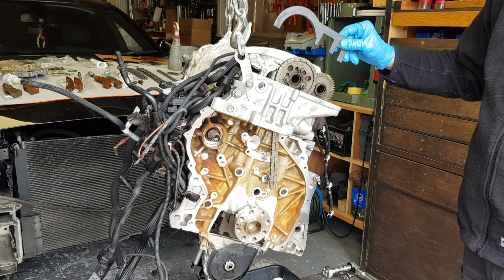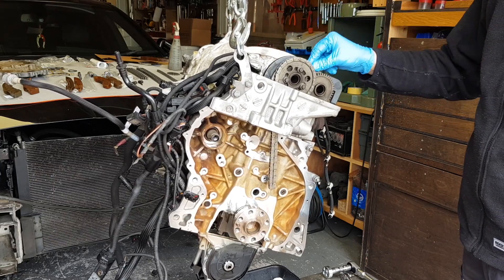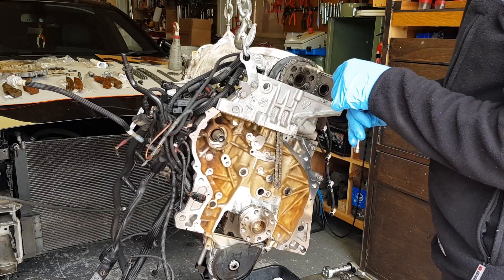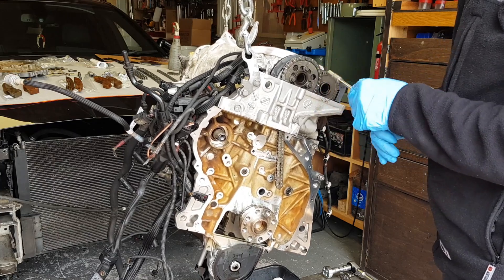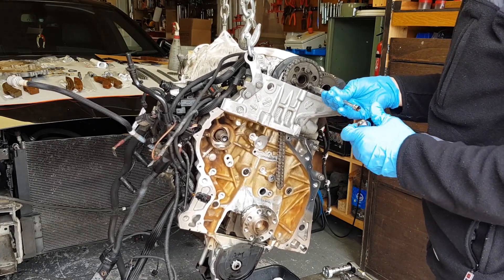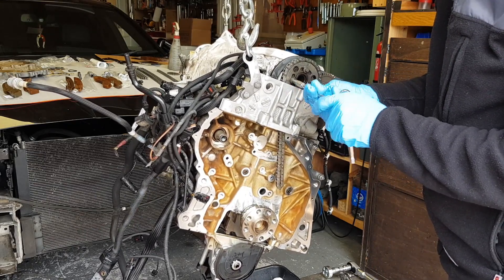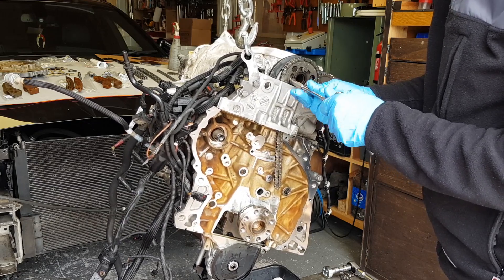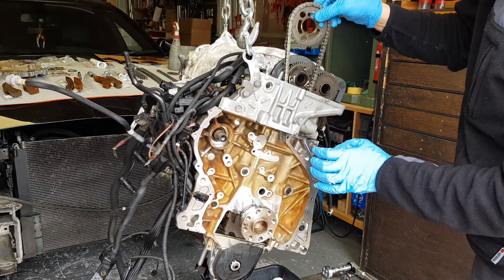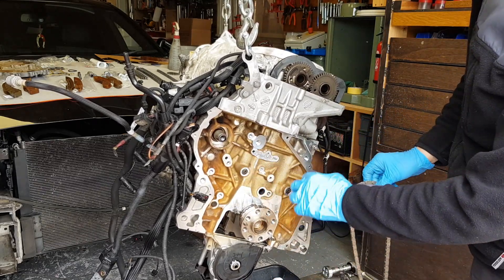You want to use your camshaft locking tool, insert it on the camshaft — these two cam sprockets are connected and this shouldn't move. Now at this point we should be able to loosen these bolts. These are torqued to 17 Newton meters so they're not very hard to remove at all. I'm dropping them down in my tray so I can rinse them, and when we install them we want them to be nice and clean. That's all the chains and sprockets removed, including the oil tensioners — the whole lot.